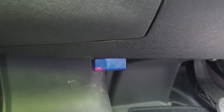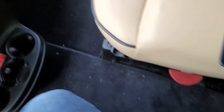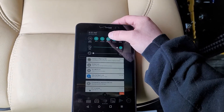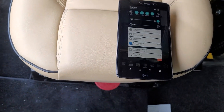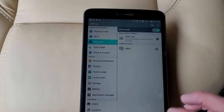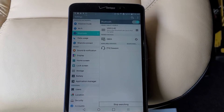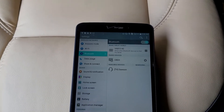Not all vehicles will provide power, but the ProMaster does when the vehicle's not off. Now on your Android device, you have to pair Bluetooth to the device itself. To do that, we have to start the vehicle. Under your Bluetooth settings, you can see I've got a paired device called OBD2. You may need to search for Bluetooth devices and select the OBD2 port — your device will probably have a PIN, likely 0000 or 1234.